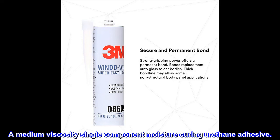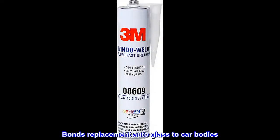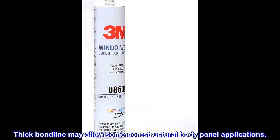A medium viscosity single component moisture curing urethane adhesive. Bonds replacement autoglass to car bodies. Thick bondline may allow some non-structural body panel applications.